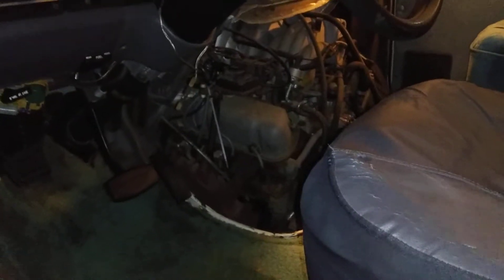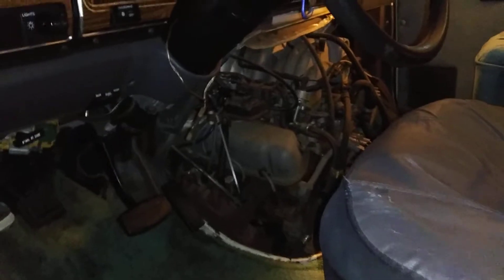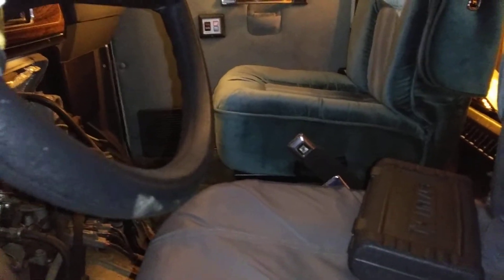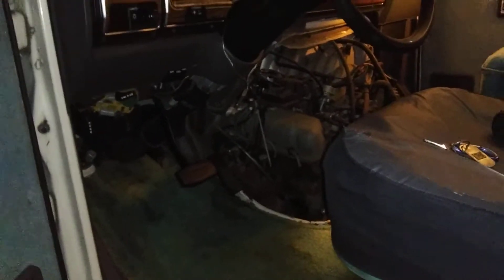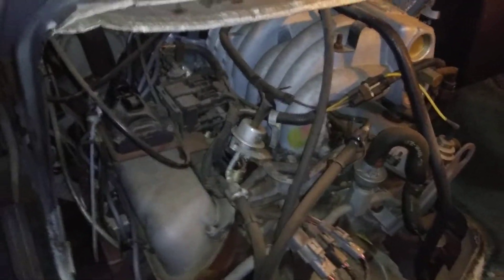Coach 9100 coming back at you. It's Wednesday night, 8:11 p.m. Eastern Standard Time and I'm almost done. I've got all the new spark plugs in, all the new spark plug wires, the new distributor cap on, the new rotor in — came out pretty decent. I haven't got the tire on yet but I've got a few more things to button up.